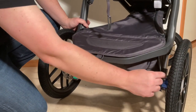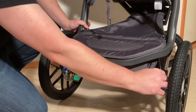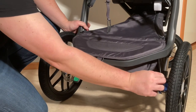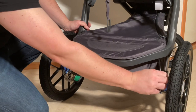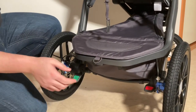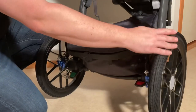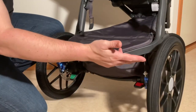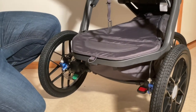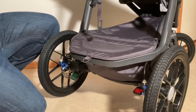Right now it's a bit too tight, and if I turn it this way — basically lowering the adjustment screw down — it will release some of the tension in those calipers. So what you want to do is find a point where you don't hear the sound, and then test that it still has a solid brake.